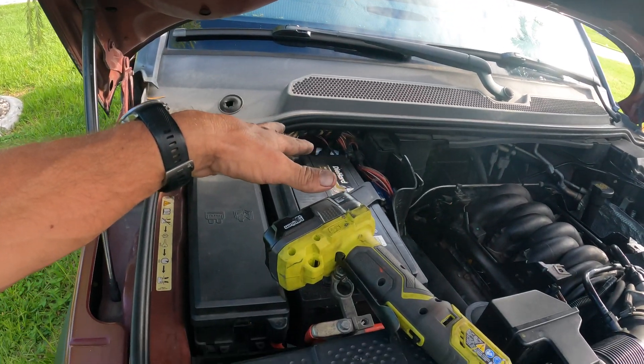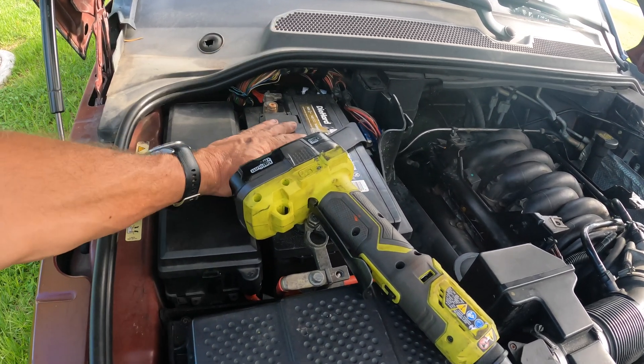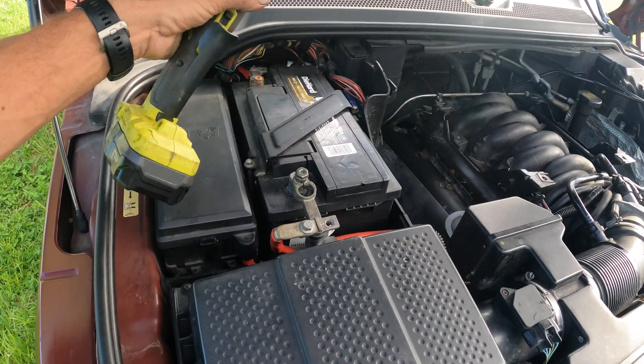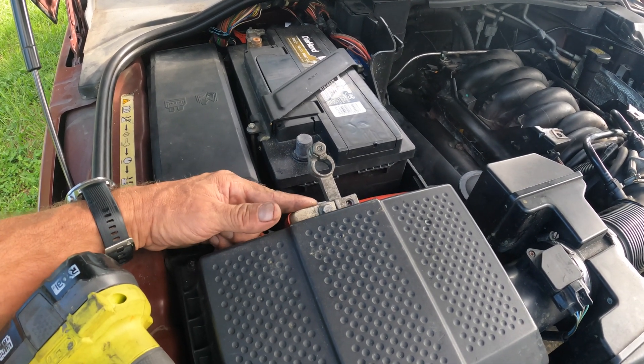What I've done here is take off the battery cover — it's on the right-hand side, the passenger side on a normal left-hand steered car. So you find the battery, and basically what you do is take off the positive pole, hold it off for 30 seconds, and make sure you keep it off.